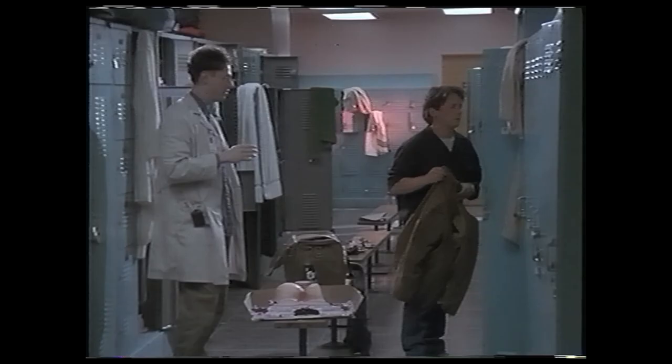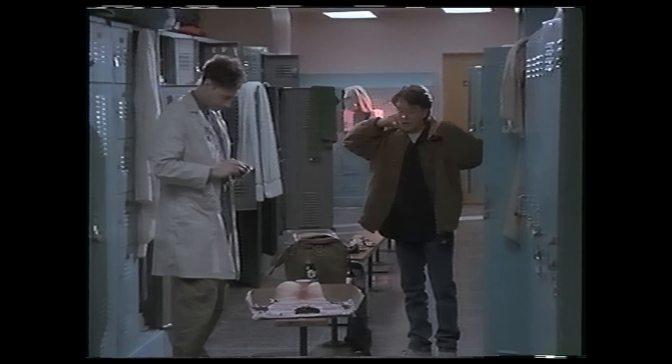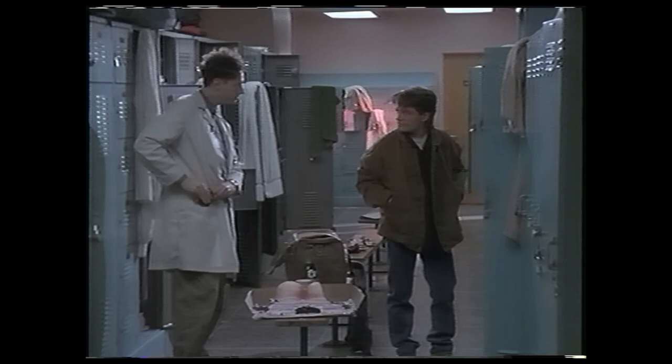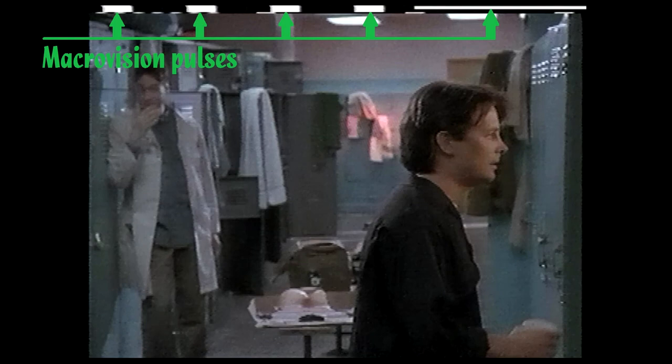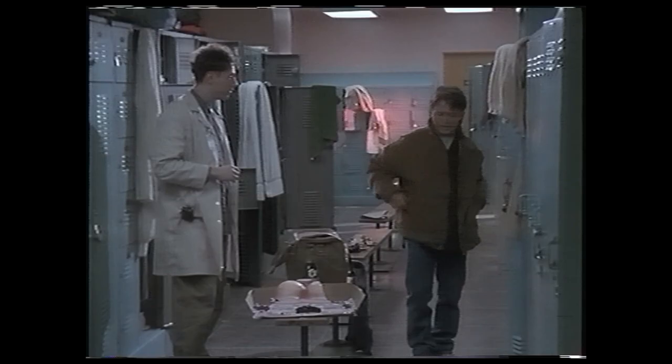As a purely scientific test, I was able to capture several VHS tapes published by MGM, Warner Bros. and Paramount. Here is a short sequence from Duck Hollywood — you can see white pulses in the blanking area. This is the very first frame in the sequence before the video has stabilized. You can see four white blocks and a white stripe — these are the Macrovision bars. My DVC-100 had no problem digitizing this video, and VirtualDub had no problems capturing it.